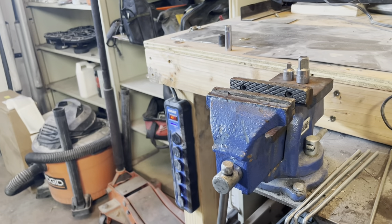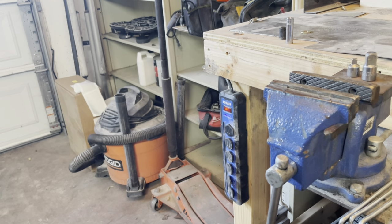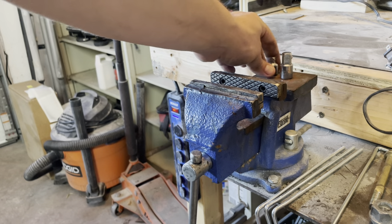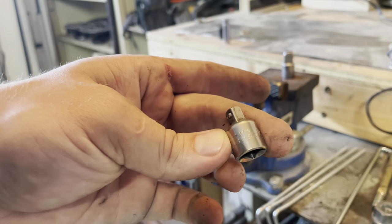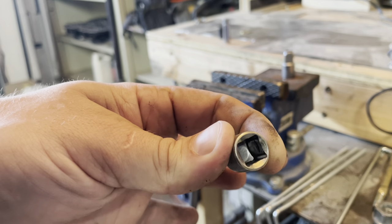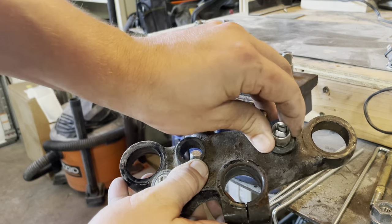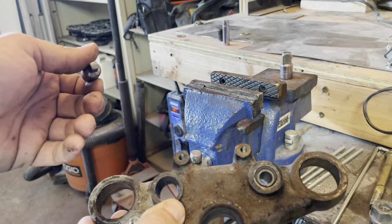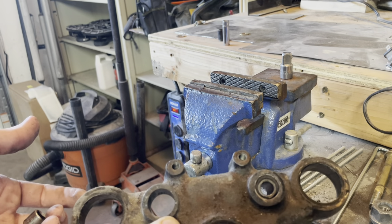Online I noticed there was a tool that's basically a shaft with a milled-down tip that fits perfectly within the center of this bushing. I decided that what might work is these two reducers — this one is a 3/8-inch to a quarter-inch reducer, it's Craftsman. Mine just happens to fit perfectly in here and it hits the inside part of this bushing. You're going to replace these, so this will damage them — you're not going to be able to reuse them. I'm taking them out because I want to sandblast and powder coat this, since I'm restoring a bike.